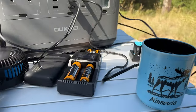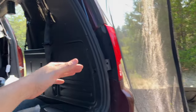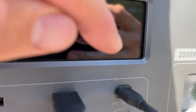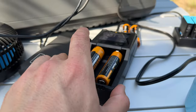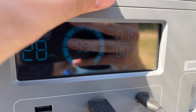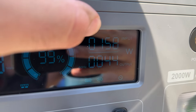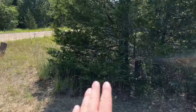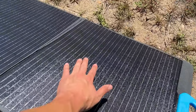Charging up a bunch of stuff while the sun is high. Got my ice-cold water and coffee cooling down. That breeze feels really good. I parked the van kind of sideways to shade myself. We're still charging at almost 160 watts — 44 watts net are transferring from the solar panel into these batteries. Still at 99% and it says 27 minutes to recharge, pulling a few watts while recharging at about 160 watts. The Bluetti PV200 solar panels — I moved them slightly as the sun changed.